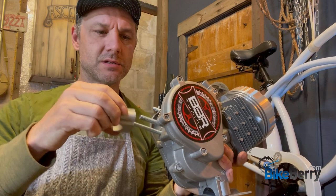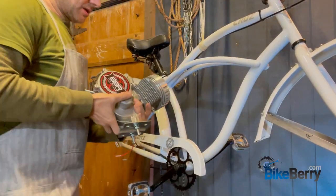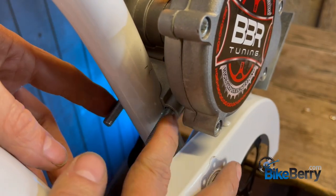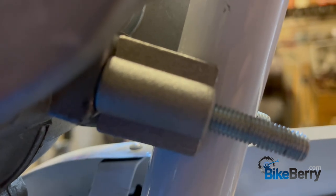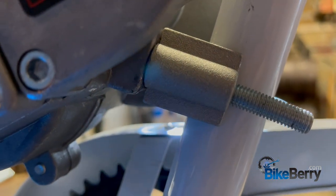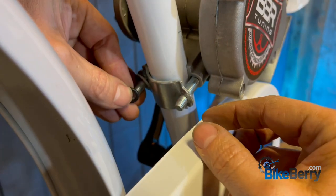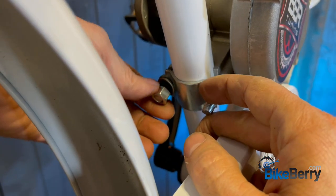Let's start by mounting our plate directly to the front of the engine. We'll add washers, lock washers, and nuts. Then on the back side, we're going to take this piece and slide it on there. So now we have our front plate mounted and our rear bracket mounted — we're going to go directly onto the frame. The Swiss cruise frame has all the right spacing. It's really important back here to make sure it is perfectly flat in line with the seat post — no gaps, everything flat. That way it won't break anything. Put our plate in here first, washers, lock washer. It's better to do one side starting out, then it'll hold it while you do the other side.